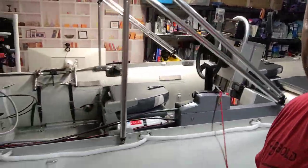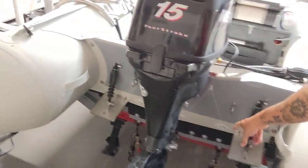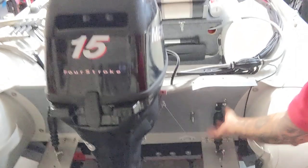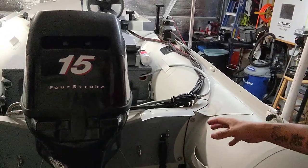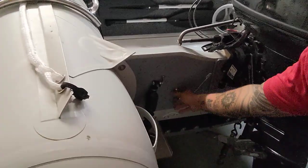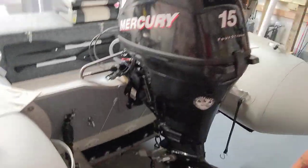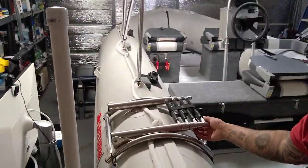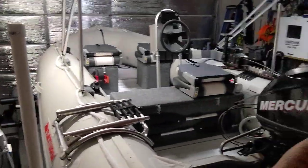Overall pretty happy with it — I'm still making some adjustments. I put some trim tabs here, which I've lifted all the way to their top setting and even higher than recommended — more like risers than traditional trim tabs. I also installed transom hooks, as you can see here, which strap down to the bottom and keep everything nice and snug while trailering so nothing moves around. I have an extendable swim ladder which flips over and drops into the water for easy in and out.